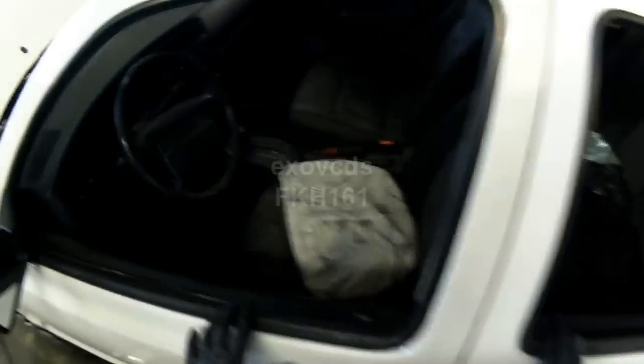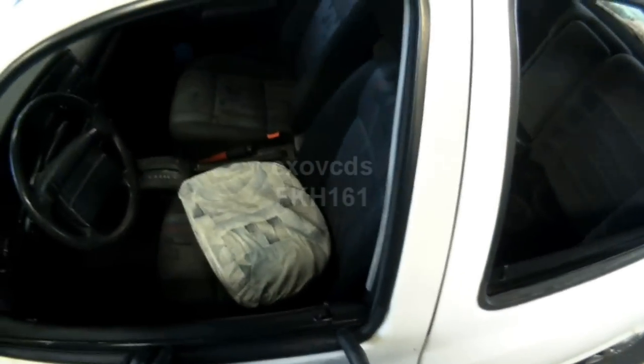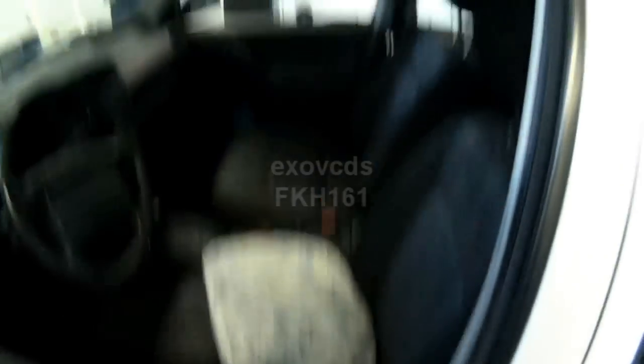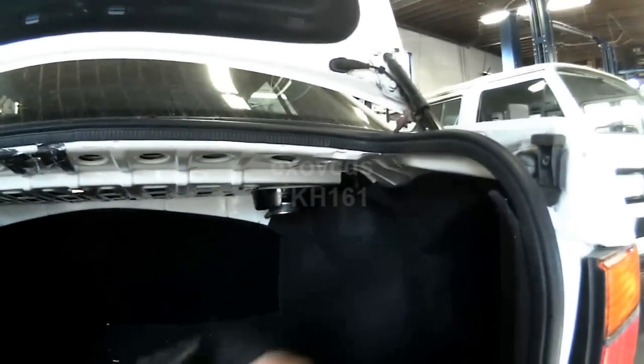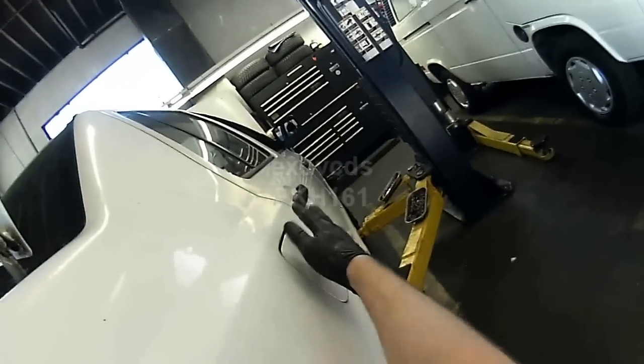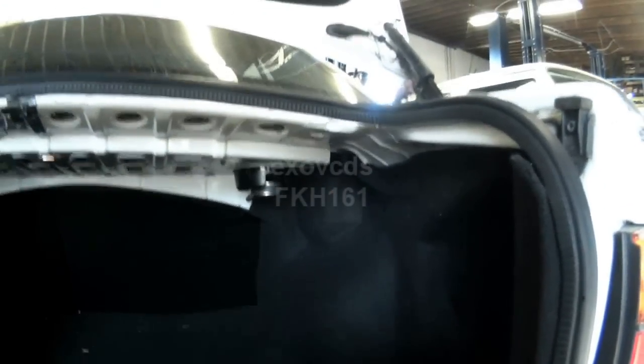With the windows down, if there is a leak inside the door panel, the smoke is able to come up through the glass rail here and should be visible — again, if that is where the leak is. So you basically just monitor to see where smoke is coming from. In the back, you look in the area where the gas cap is. Smoke shouldn't be coming out of there, but if at all it might come out in that area because that is where the vacuum motor is.